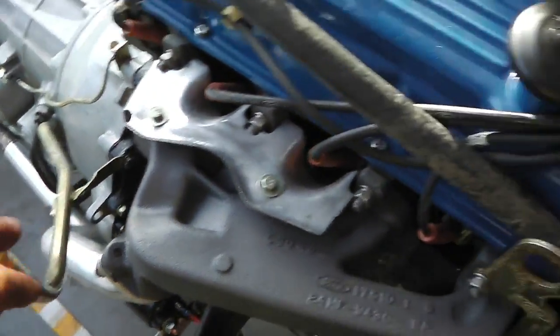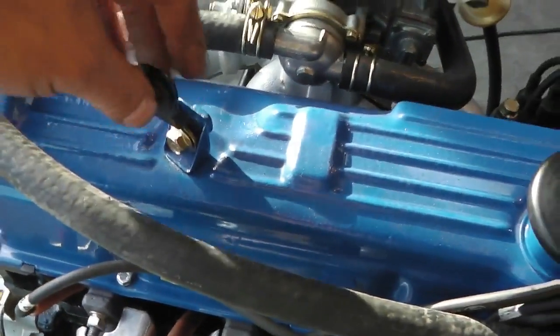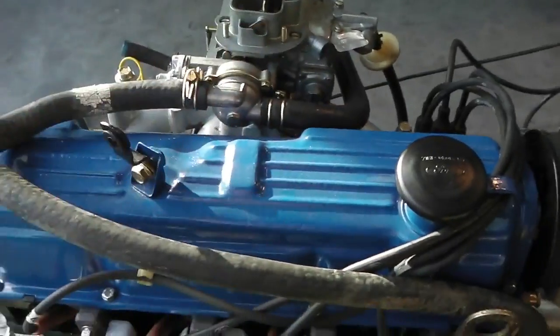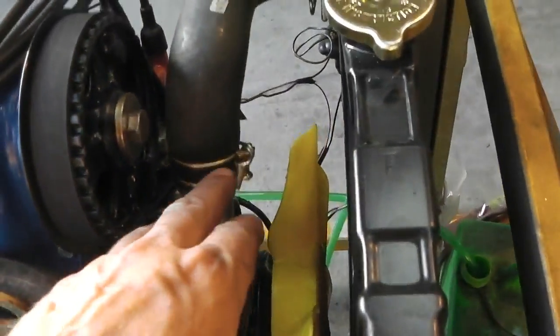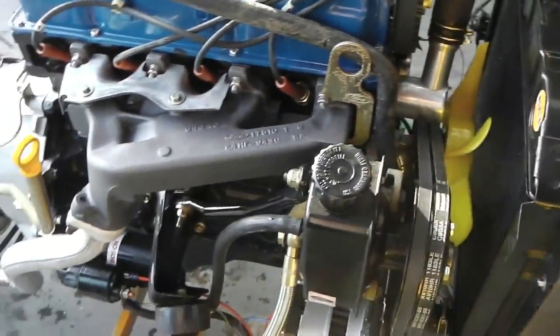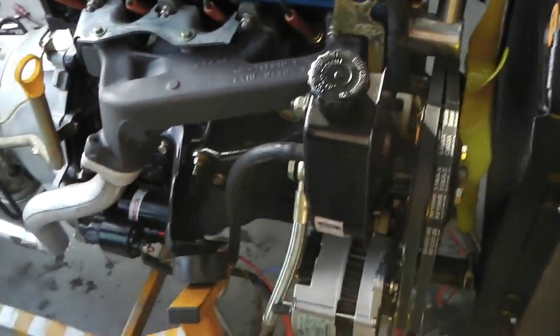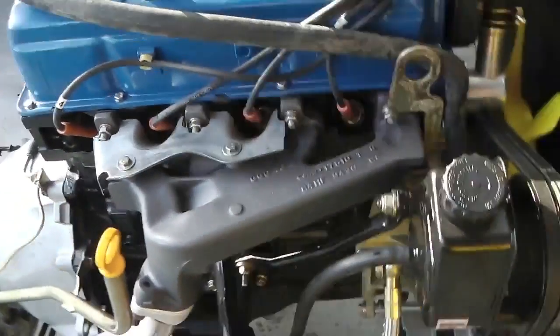Check that. Okay, so we look now for rattling bolts, anything loose. Yeah, okay, that's the air cleaner one. I've just nipped that up because I'm waiting for the air cleaner to go on. No leaks now coming from those clips. Nothing overpressuring. Temperature staying in the normal range. Everything looking good. Nothing, no oil dripping down at the bottom. No noises or hisses or anything like that.